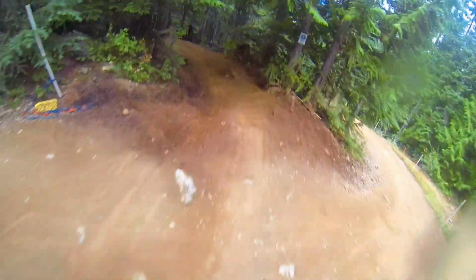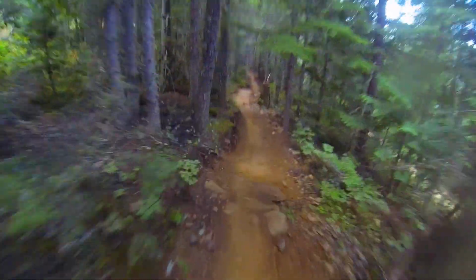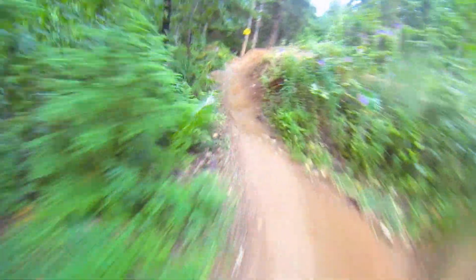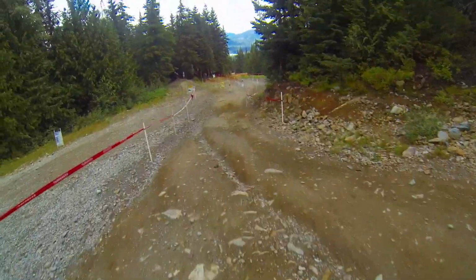The bars on this bike are aluminum, and they are 780 in length. I'm guessing they couldn't go the full 800 on a 31.8 clamp, because either the bar would have to be too heavy, or they just wouldn't have the strength there. That's why companies went to 35 in the first place, to keep the bar light and be able to get that extra long length.